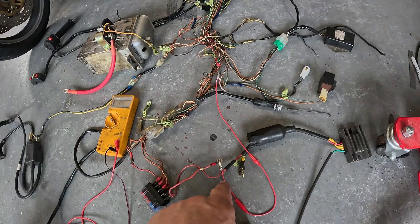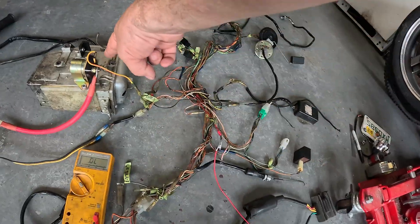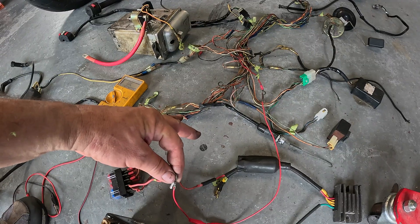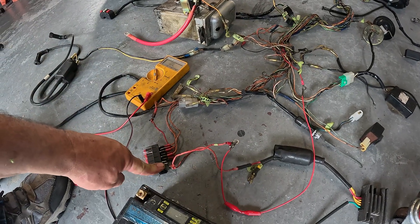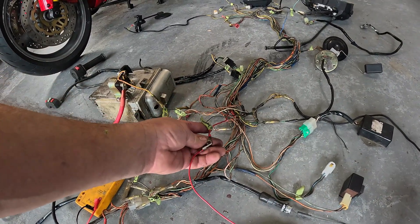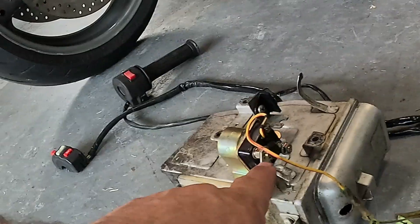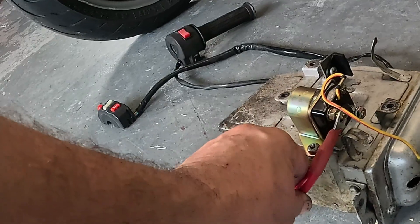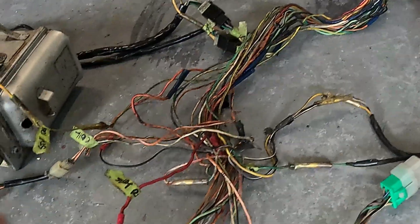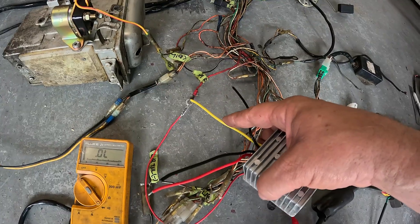The hot wire goes from the battery, sending 12 volts to the key switch, but it does it through this relay. You take your two wires off the relay and remove the whole relay system. You're going to have to go from the 12-volt converter not to the wire going to the fuse box — we don't need that one — but to the one going to the key switch. That wire coming off the starter relay to the key switch is the one we're going to keep, and that's the one we'll use for our input.